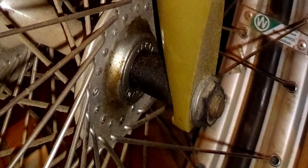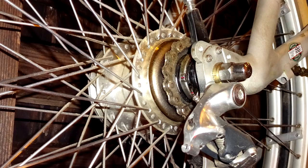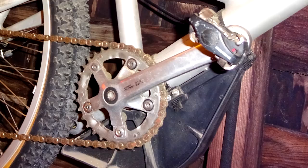Looking at the rear triangle, it's hard to tell what was done. I compared it to pictures of other 1991 Cannondales and it looks very similar, but there are some welds that don't look stock, so the top part might have been widened slightly — I'm not sure. For gearing, he used a Shimano Nexus 7-speed internally geared hub on the rear, which I'd guess offers more protection from wet muddy conditions than an exposed cassette with derailleur system. On the front he used a single chainring crankset, looks like a 32-tooth chainring, with a derailleur being used as a chain tensioner.